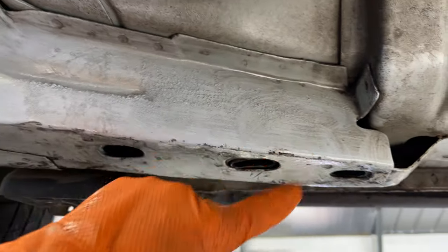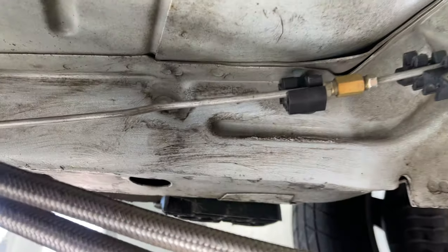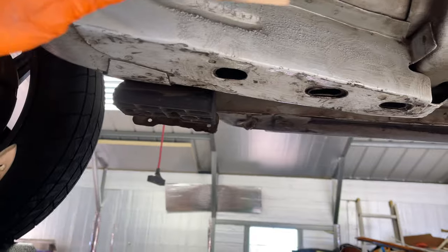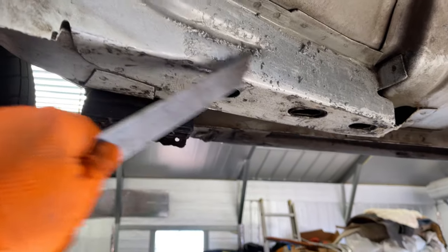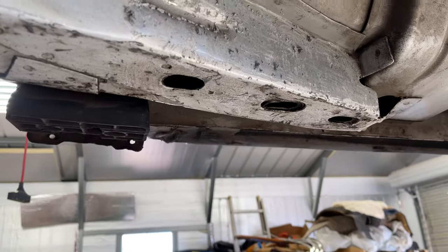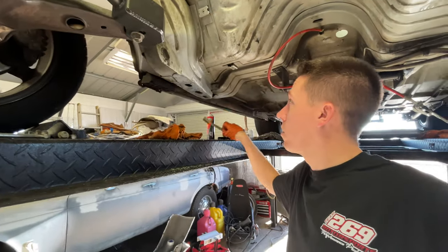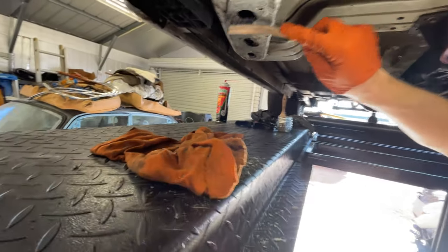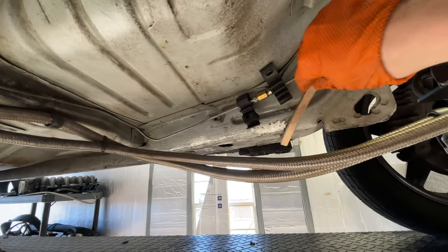Looks like it's working pretty well - it's bubbling and starting to peel all the paint off. This side's got a little bit where it's starting to peel too. I'll come back and start scraping. I'm going to sacrifice one of my stainless welding brushes for scraping in all these little areas and getting up beside the frame rail. A lot of it just peels right off. It does say it might take a couple coats to get completely clean, but it's coming off pretty nice. About two to two and a half coats on most of it and it peels right off.